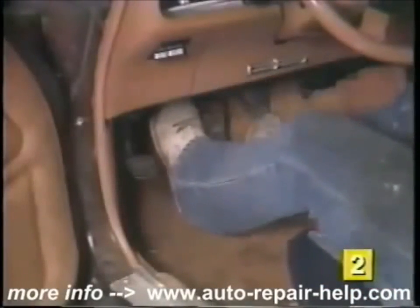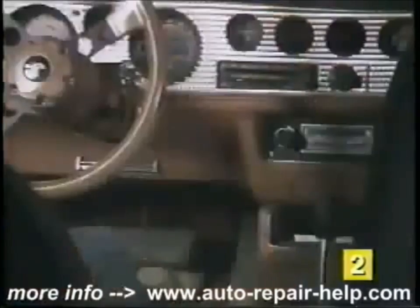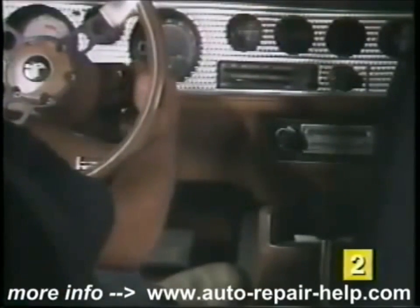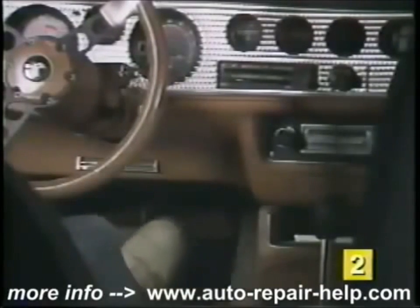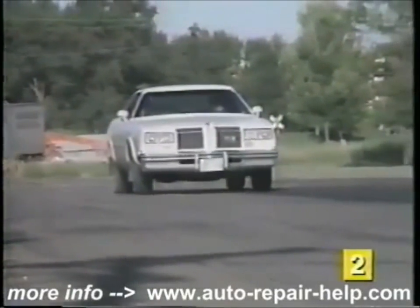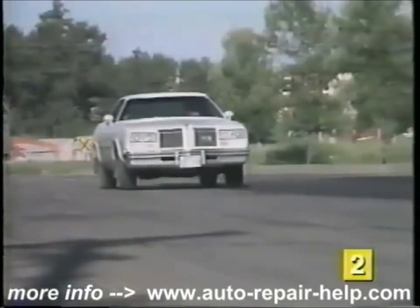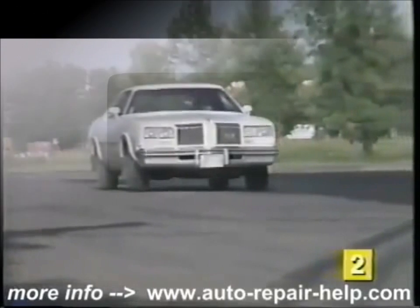Lastly, depress the brake pedal several times to ensure the pedal is at the proper height and is firm. If the vehicle is equipped with power brakes, you may have to start the engine to feel a firm pedal. Take the car out and test drive it, making a few easy stops at first. You're done. You've saved yourself money and at the same time gained the satisfaction of doing your own automotive repair.